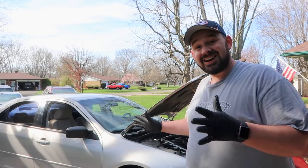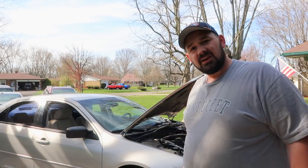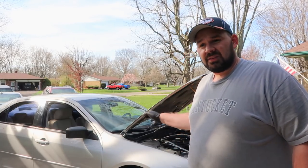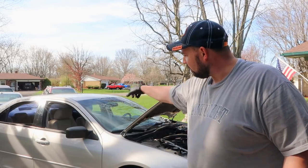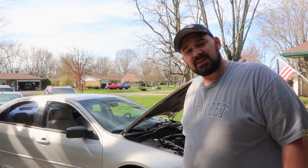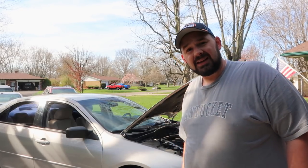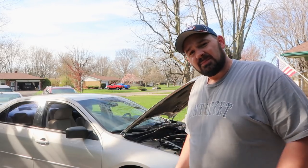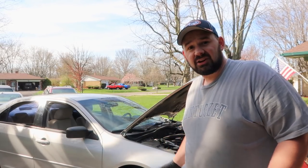All right, Fusion's done — except for one more thing. That's figuring out the passenger seat occupant sensor situation, which is causing the airbag light on the dash. The code says it's the occupant sensor. So I have loosened the bolts on the seat and I'm going to just tilt it back and check all the connections. It's kind of a last-ditch attempt to see if we can clear that light before I go out and actually buy a new occupant sensor. I'll unplug everything, make sure it's clean, plug everything back in, re-secure the seat, and check to see if that cleared our code — fingers crossed.